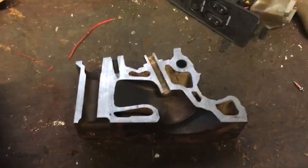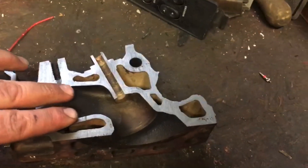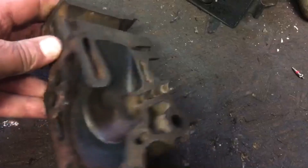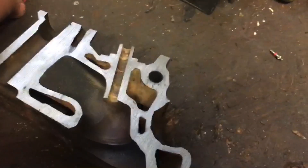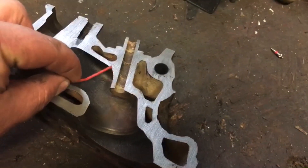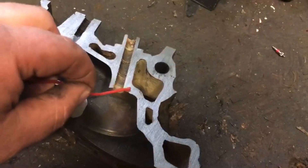All of this here is water, and this is your valve guide. Looking at it, it looks pretty good right here, but as you go in it just chokes down big time right there — y'all see that big choke point where the valve guide is? So what I want to do on the next set of heads I port is trim this and just do away with this part of the valve guide, so the only thing in there is the valve stem. Leave this here but trim this out — it would make a pretty solid difference.